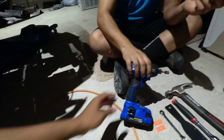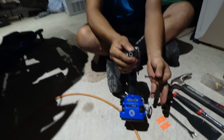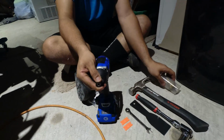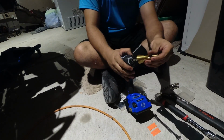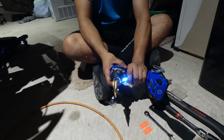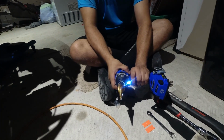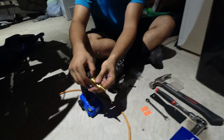Yeah, so this is why you need an impact driver. The impact drivers have these quick disconnect fittings. You can kind of see that right here on the end. And that's what you're going to have. You're actually going to have that also on the drill bit. And the reason an impact driver is so great is that it allows you to adjust the speed by just how hard you press the trigger. Right? So that's really going to allow you to have that control that you need while drilling through the sump. So that's why we recommend this as part of the kit.